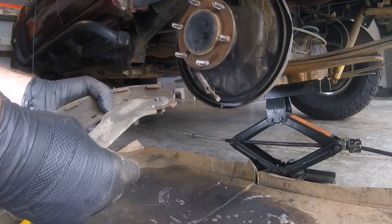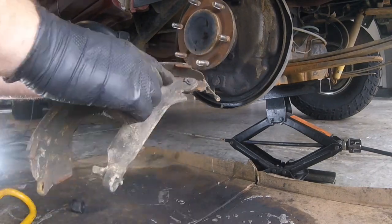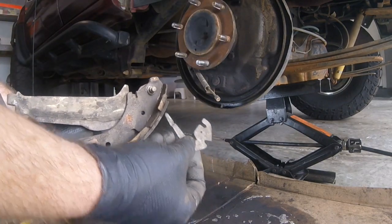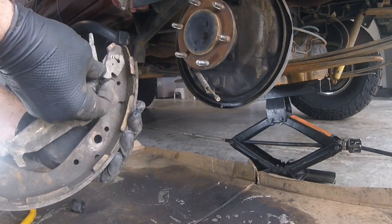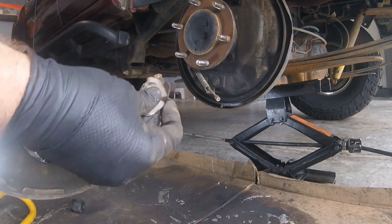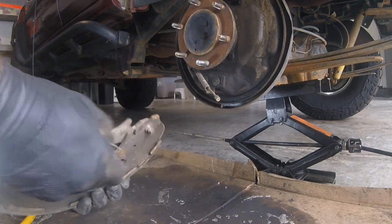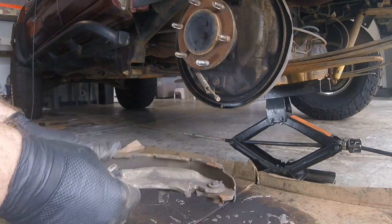This is going to be part of the park brake assembly. There's a little horseshoe clip you need to remove, and there's a wave washer on the back side. The stud that sticks out on the side — they're not the exact same; the difference is in the slot. So this will only fit on one side, and that's just so that you make sure you get the brake lever on the correct side and don't misassemble. It's a nice design for assembly — you design the asymmetry into it so that mistakes cannot be made.